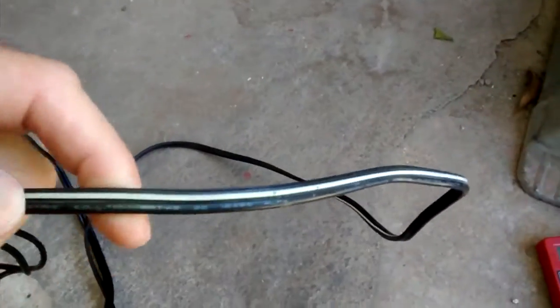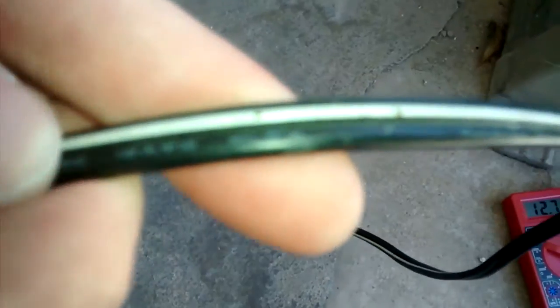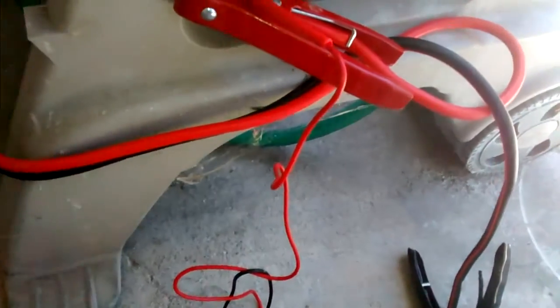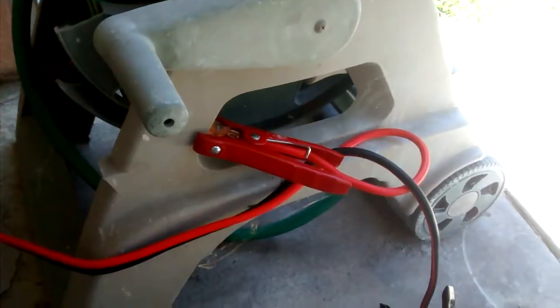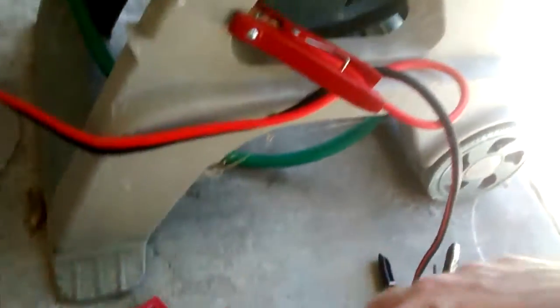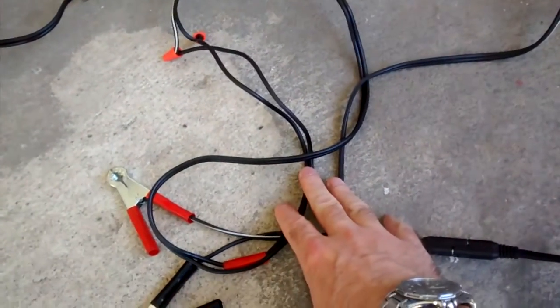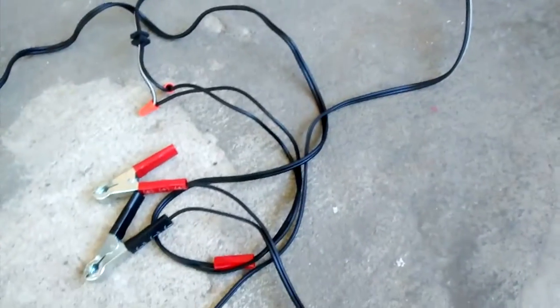With the 18 gauge wire the percentage drop was about 2.3%. Now let me check the 8 gauge wire — Walmart claims this is 8 gauge — and the math comes out to about a 1.7% drop in voltage versus 2.3% for the original wire. Both are well under 3%, which is acceptable, but I still believe this will work far better. Also worth noting: the original thin wire heats up like crazy — after about two minutes you can barely touch it. It just heats up way too much for my comfort.